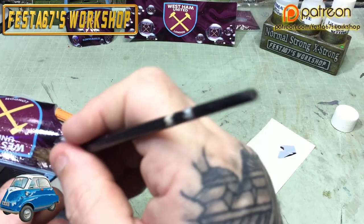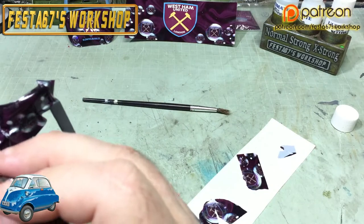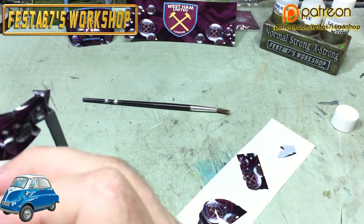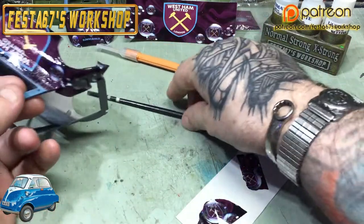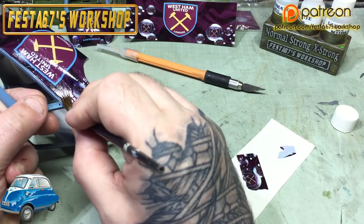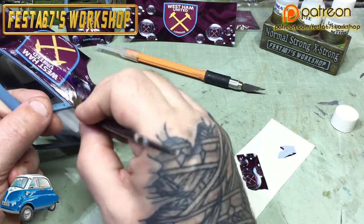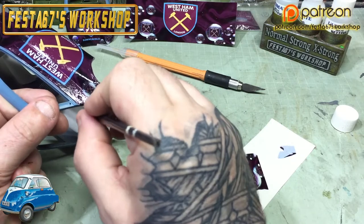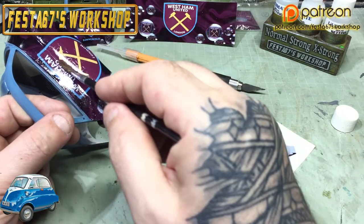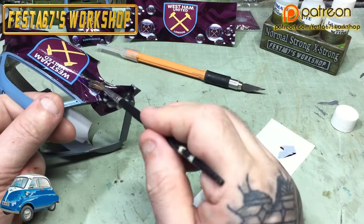Just bring that one back up to the swage line there and start fanning it across there like so. And then really start putting a bit of pressure on the brush now, just to stretch that over. Where that little dimple is where the headlight is going to go, see? So I've got a rough idea of where I can lose it. And now I'll just go back along that swage line just to make sure that that's sinking how we want.